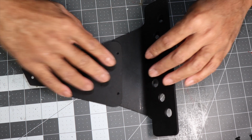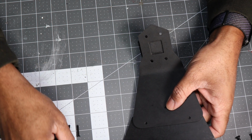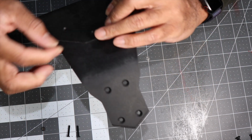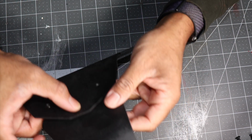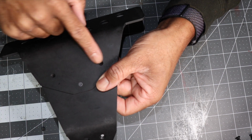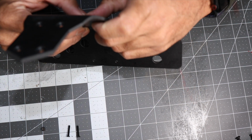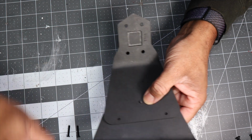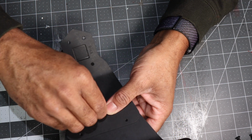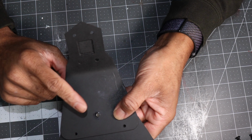So we're gonna use three fasteners for that, and let me pop those out. All right, so again, you're gonna take one of these, and I know it's gonna be hard to see, but one of the shorter flathead screws right here. You're gonna run it through the rear of the bumper and into the bracket that affixes to the body. So you have three holes here, one, two, and three. Center hole, short screw. You wanna take one of the black washers, all right? Put it over top, and then one of the nylon lock nuts. Screw that over and then tighten it down.